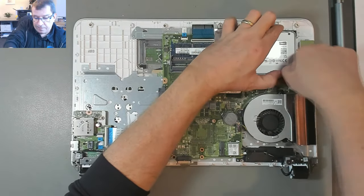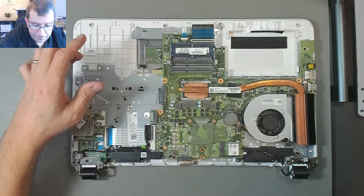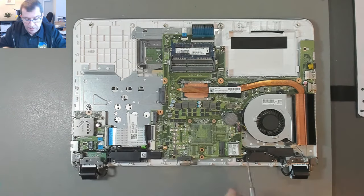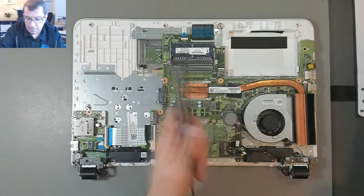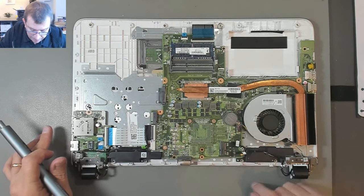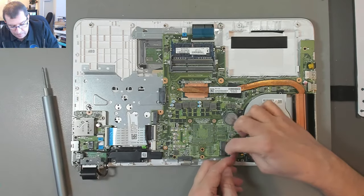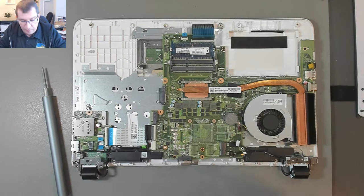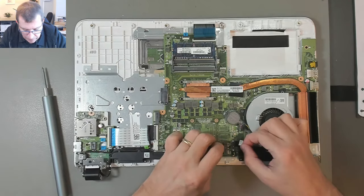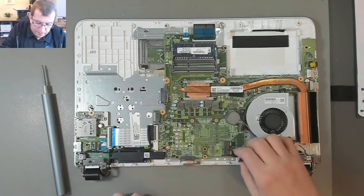This should lift up. It lifts up from the front. These are stuck in there. Yep. Okay. There's the motherboard. So the Wi-Fi adapter might as well come out. Now I've got, looks like a speaker wire and maybe the webcam connector, I don't know. So with the speaker wire, the red is closest to me, closest to the back hinge. Very tight connections, I don't think these have ever been disconnected before. That's very tight. Okay. So that's free.